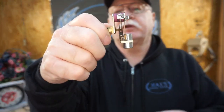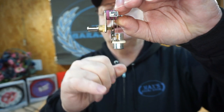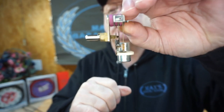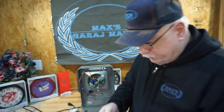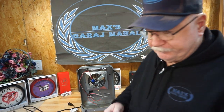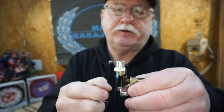What we want to do now is get a couple pairs of needle nose and reform this arm so it's got a little dog leg that way and that way, so that contactor comes over and slams together when you turn the heat up. I'm going to bend this a little bit further — there's a factory place in there where they tweak these things just a little bit to make them come closer together. I'm not telling you to do this at home. This is for entertainment purposes only. This is effective, it does work, but I'm not suggesting you try it.